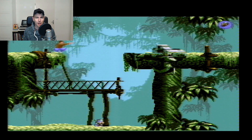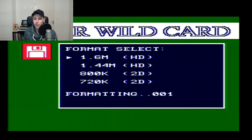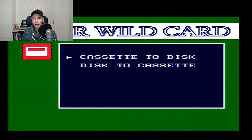Now we're going to try making our own backup. The game I have inserted is Another World, another one of my favorites from the Amiga — that's the system I played it on. I grab an empty disc, insert it into the device, and format it first. It formats to 1.6 megabytes. Now let's go to the last icon where we can create backups. You can play the actual game using the pass-through port, but we're going to do a data transfer — cartridge to floppy.